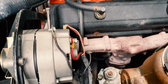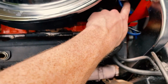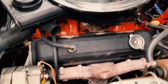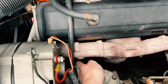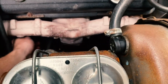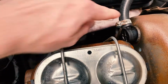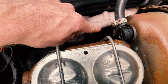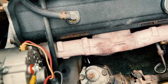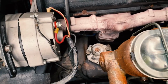Let's see if we can spot. I see that little blue wire is a spark plug wire. You can see coming from our distributor up here, a spark plug wire. So I know they're blue. They're only blue wires under here. So underneath here, I can see there's one of them, and I don't think I can get it. You maybe can see a little bit of it just beneath this part right there. So I can spot 2 on this side, but of course, each side of this V8 should have 4 spark plugs, and I'm sure there are more, but I can't see them from above.